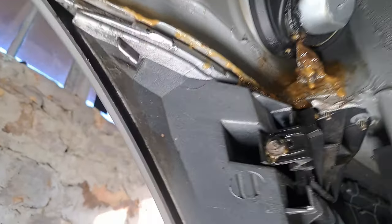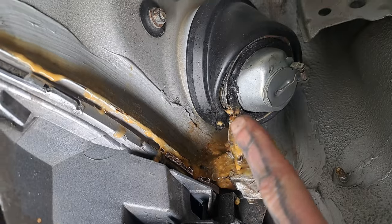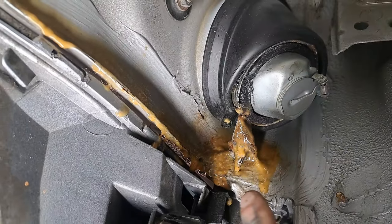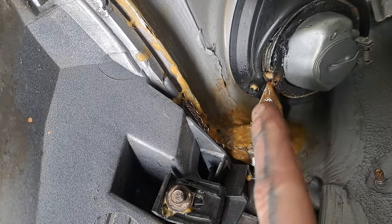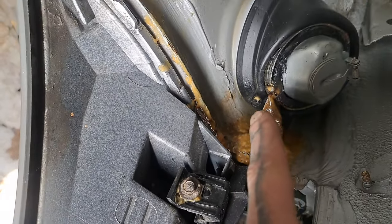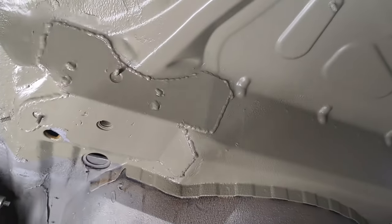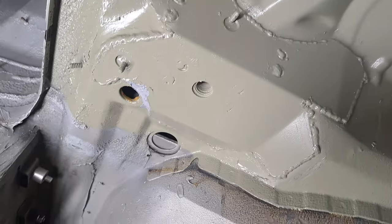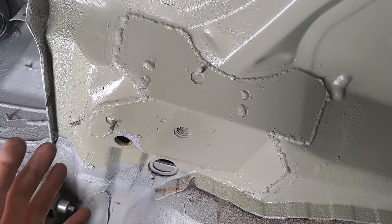When it comes to the filler neck, we're also going to see rust forming on this bracket here. Right here is a little weep hole for whenever water fills up this boot — it's going to drip out of here. I also suspect water drips directly onto this bracketry and flows down this way, rotting this all out. So I'm also going to put a brass barb or a plastic barb fitting in there and route my own drain hose down here somewhere. That's also going to be a key cause of rust forming in here because that drain is in a very dumb spot. I'm also going to apply some cavity wax — I already did — following my subframe reinforcement, which was my last video. I sprayed it all through here. I did have new plugs in here, as you can see the seam sealer, but I thought that was kind of dumb, so I popped them back out because I wanted to spray cavity wax all through here, mainly because we were just welding. I do not want corrosion to begin happening on the inside of the body.